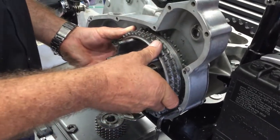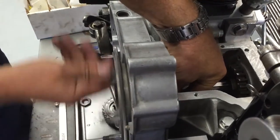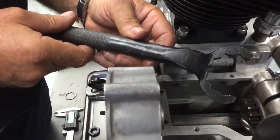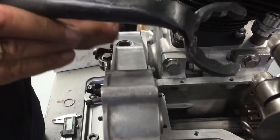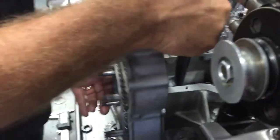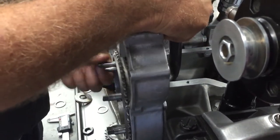Slide the clutch sprocket in. You've got the clutch sprocket nut — make sure the flat side, which is actually a washer face, always goes against the sprocket. Slide it over the main shaft. This is a special tool we made up with double hexes in here that allow for fine adjustment for general installation to get it tight. But the final tight has to be done with a hammer and cold chisel — as brutal as that sounds, it has to be tight, otherwise it will come loose. There's also a lock washer under here.